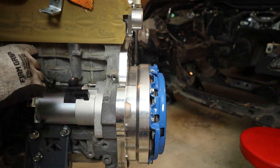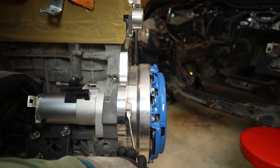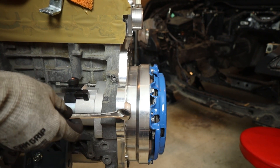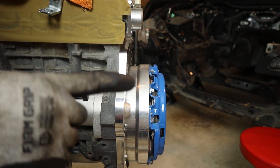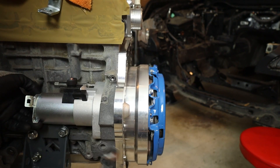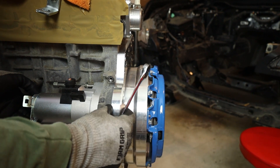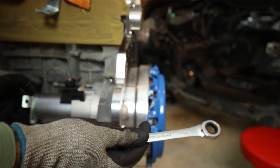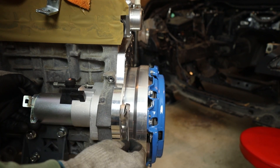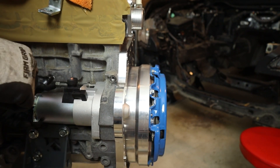I'm going to get this bolt tightened down so the starter sits in place, then measure how much I need to cut from the bell housing. I'll take this adapter plate off the engine and place it onto the transmission so I can see where it lines up in terms of circular position. I don't want to cut the wrong spot. So I'll measure the distance, put the bracket onto the bell housing, see where the starter tip lines up, mark it with a Sharpie, cut it out with an angle grinder, and move on.